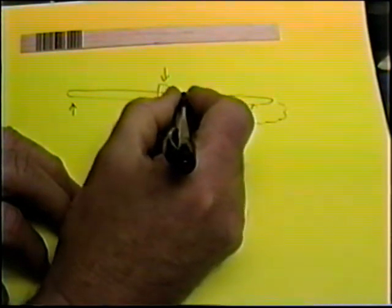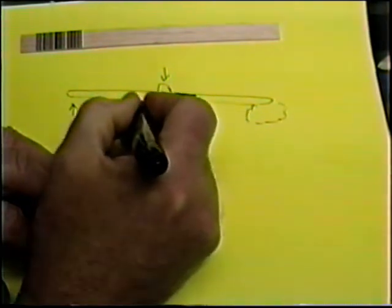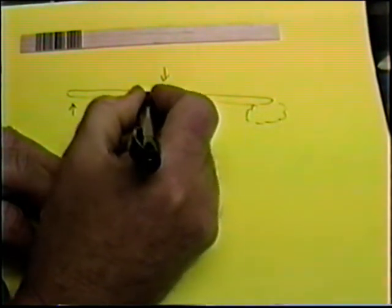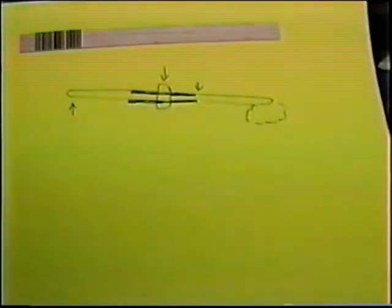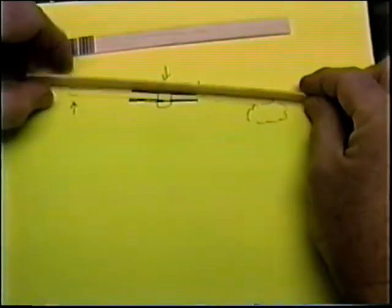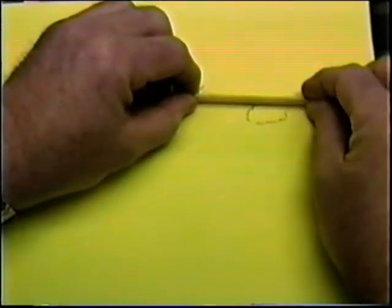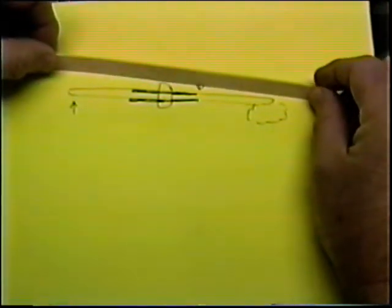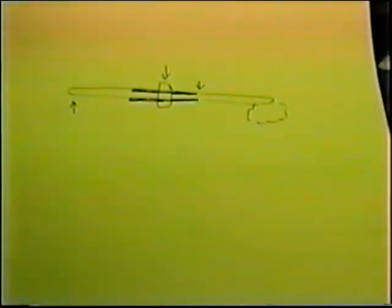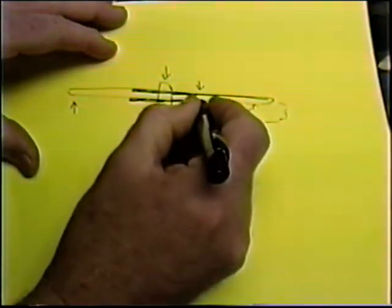The MIG was carbon fiber like this. I think I showed a picture of that on this tape. So now what happens is you build a span loading stress riser right here. In other words, you're flying along, and nothing's bending up to here, and so this has to bend twice as much. You see what happens? So when you do carbon fiber, or if you're going to beef up a wing, the best of all worlds is beef the whole thing equally.